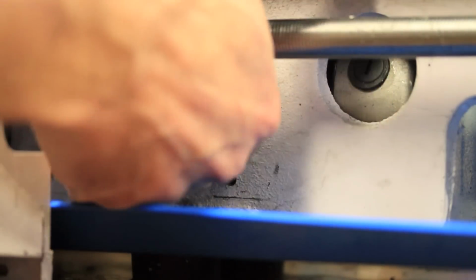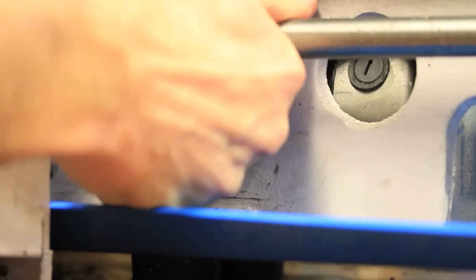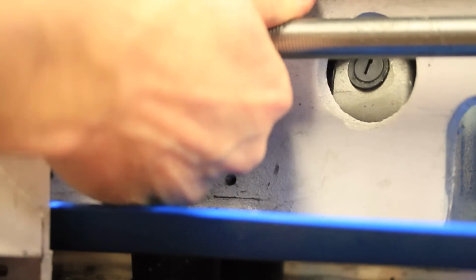Turns out the problem is that the motor was just loose. I don't know if they never tightened the bolts originally or it came loose in shipping. But the motor side of the belt drive was hitting the frame of the lathe. Here you can see where it's contacting.